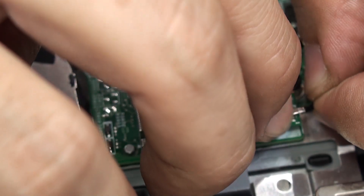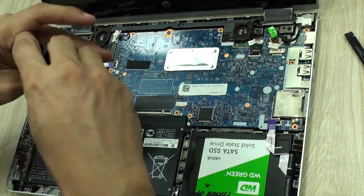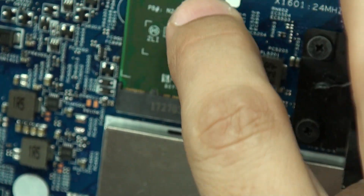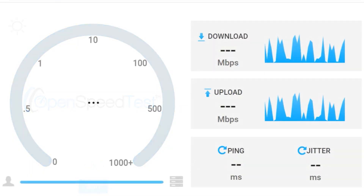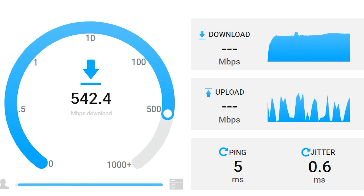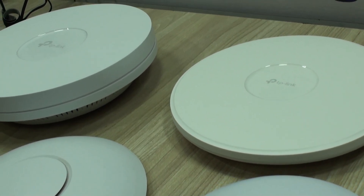We then went for this HP laptop with a 7th generation i3 processor — the one that had the Wi-Fi 6E card. Drivers are installed automatically if you connect through a network cable while the PC installs the drivers. It worked without a problem, or so it seemed. In terms of performance we found a lot of issues, especially in Wi-Fi 5 and Wi-Fi 6, where link speeds were according to the standard but actual throughput speeds were not. Our speed tests didn't let us surpass certain limits even though link speeds were much higher — something pretty weird. We always got the same results: great link speeds but very low throughput. We used many APs that we had tested before with extraordinary performance, so we ruled them out as the problem.